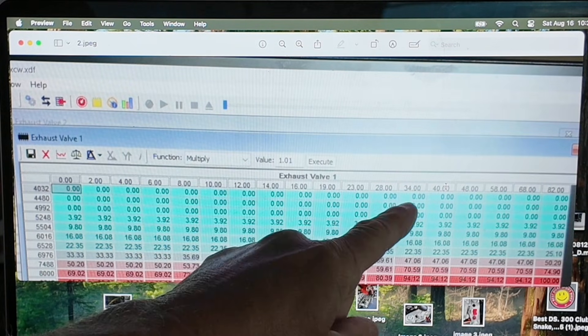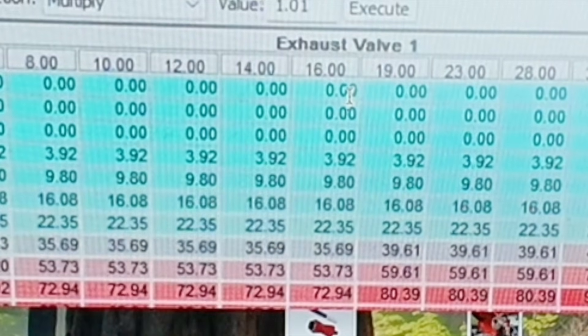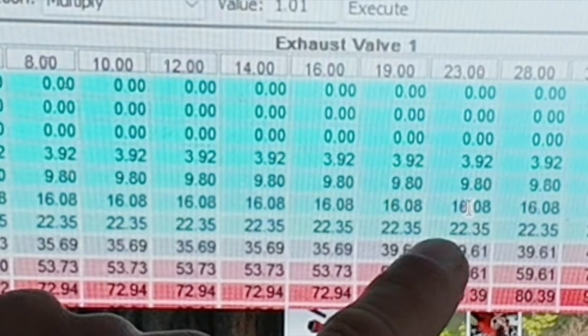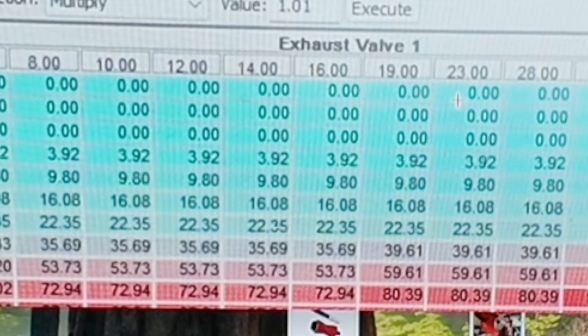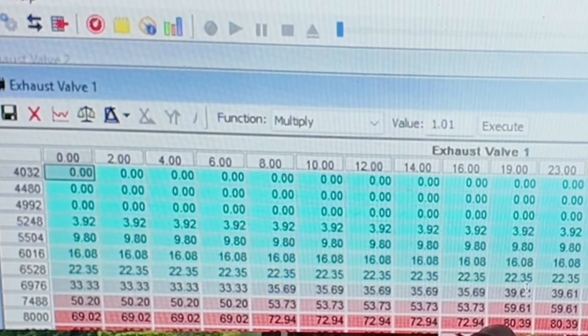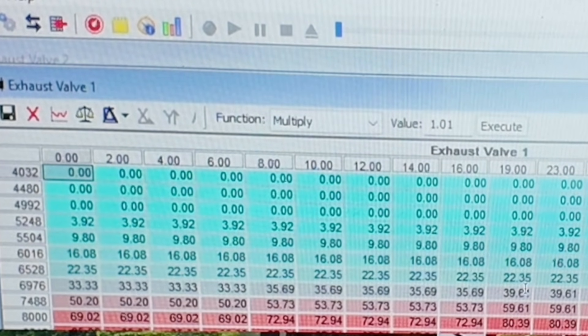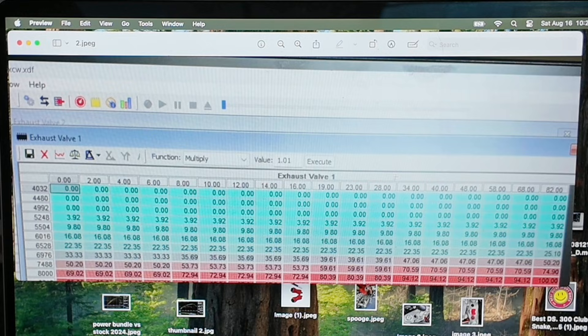Wide open would be about 50% throttle. So right here where we're playing around — 19, 23, 16 degrees — anywhere in there with a quarter throttle that I was just showing you, in this RPM range of 6,000 to 6,500, we're only running 16% of that power valve open, and then we go to 22% open on that power valve. With very limited air coming in and very limited air coming out, it's pretty easy to see why the power just doesn't grow much and peters off. Even though it does open up more, it opens up slow as the RPMs increase even though the throttle hasn't opened. That's why you saw that decline of power on the track — you have no more coming in and what's going out just isn't helping. It's not opening radically enough or fast enough to show any increase.